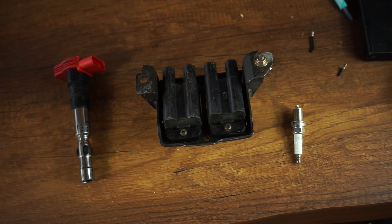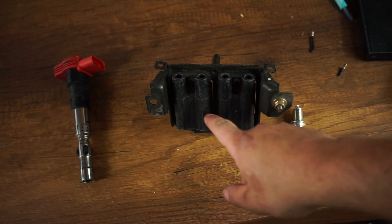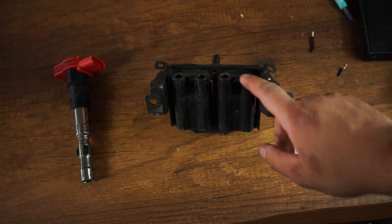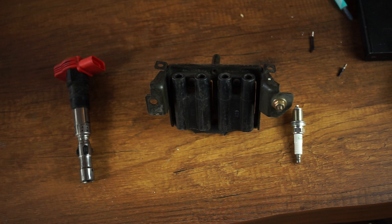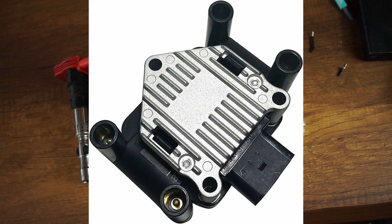In this system, power isn't really the issue, but most of the time the stock ignition coils are just pretty weak, and the spark plug wires are also a limiting factor — they often break or are not high quality and therefore limit the power delivered to the spark plug. A different method would be the single-fire coil: a single coil that electronically and internally distributes the spark to all four cylinders without a distributor.